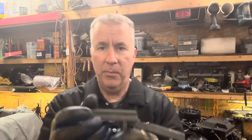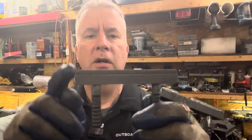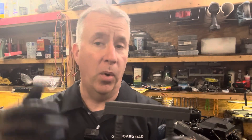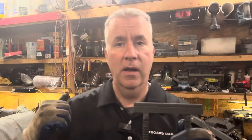Let's answer that question about those modified stones and how I made them. I took instruction from a gentleman that had been doing this many more years than me. This is a typical honing stone — a 100-grit honing stone. You can do it with 200 or 300, you don't have to do it with 100-grit. As you see, we have a stone across the whole surface, and this rotates in the tool to shave off or hone the cylinder, and it can be used for boring as well. In my videos for the Evinrude Johnson rebuild I'm doing, that one shows me doing it dry with the 100-grit because we remove a lot of material to get all the scratches out, and then I go in with the finer stones when we get close.